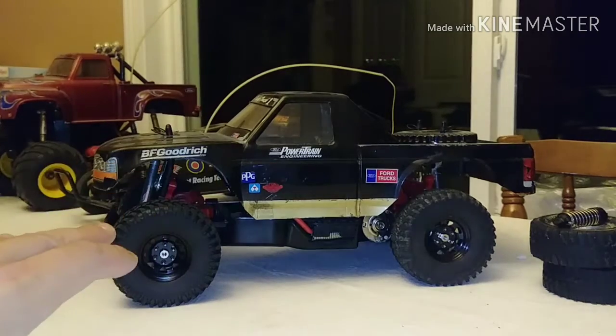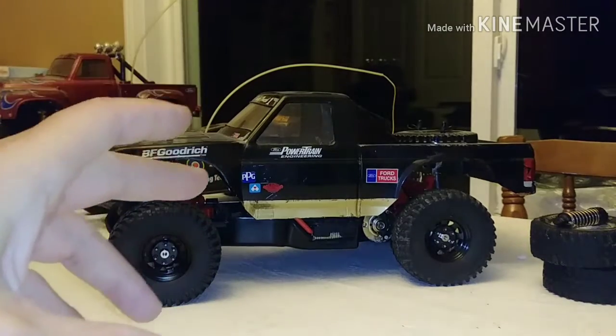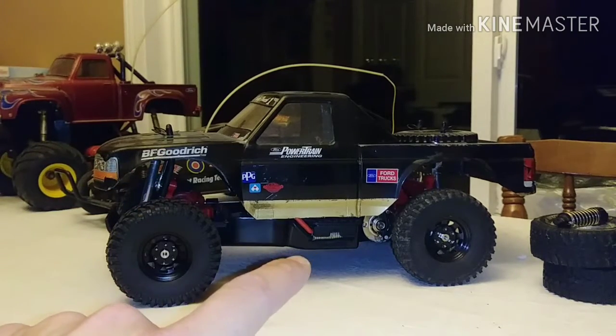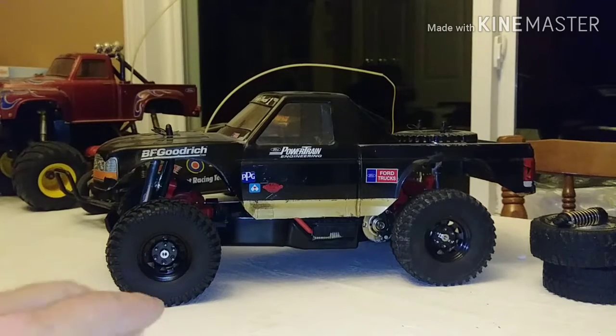Since I worked on the truck, everyone, I converted it from the old school nickel metal battery over to a LiPo, put an Axial AE5 ESC in there, still running off the old school Futaba steering servo. We took out the stock 540 motor. We were going to try to make this into somewhat of a crawler, air quotations on that. Put in an RC4WD brushed 35-turn motor.